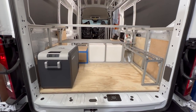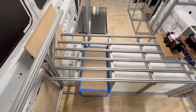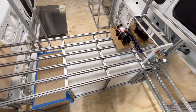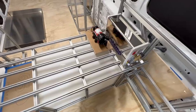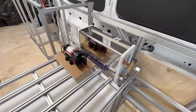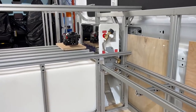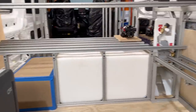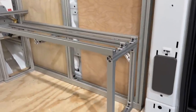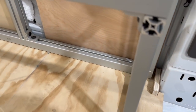The garage area in the Big Beautiful Beast is falling into place nicely. My focus is on a minimalistic design. Each segment is absolutely necessary to the structural integrity of the module. No loafers. Look how nicely that beautiful water heater tucks into its little cubby. Low and out of the way, and accessible. I use 1/2-inch plywood scraps along the walls to act as stand-ins for the actual finished walls coming in later. This allows for precise measurements and fitment of the modules.